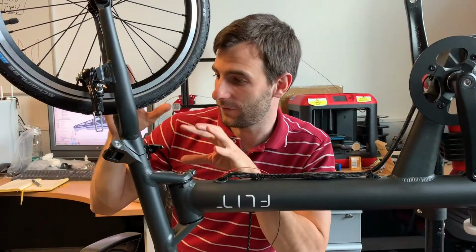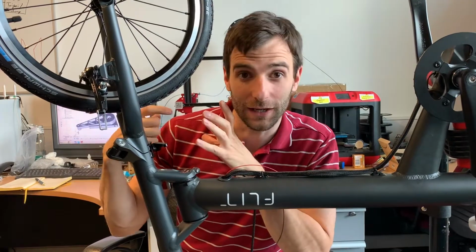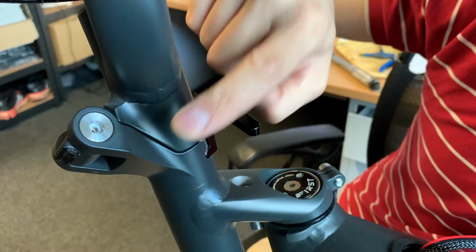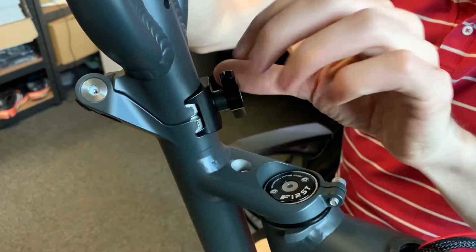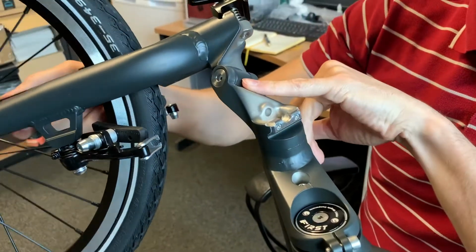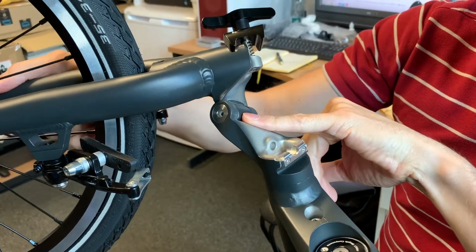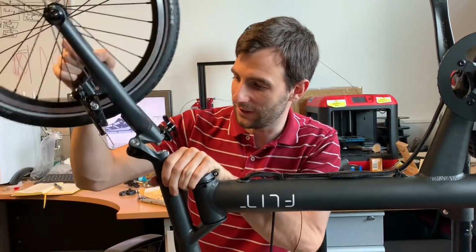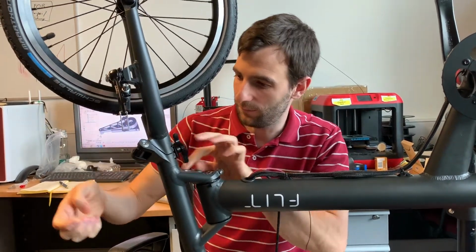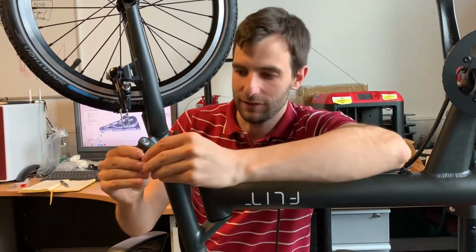So another part of this front assembly that we've reworked to make it a bit easier to service is these hinge pins here. So these were originally a pin that was pressed into the joint, but what we've got now is a screw-based system which enables it to be easily removed. So we've still got this really nice, completely play-free motion there, but it consists of these steel parts here.